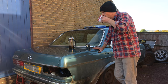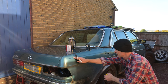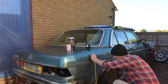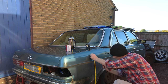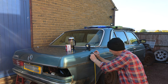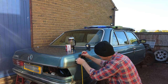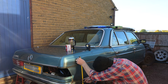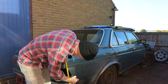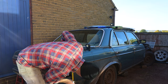Right, next I'm going to start making some pre-cutting measurements so I know what shape and position everything needs to be in when we're done. I mean it's optimistic, but it might work. I'm going to choose a datum point — we're going to use this ridge, this swage line just here, because that isn't going to get cut. That's original metal. So measuring down from here: at this point it's exactly 35 centimetres, at this point it's 34 centimetres, and at this point at the end — at the level where it meets just there — that is 25.5 centimetres. To the lip: 26.